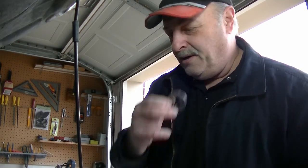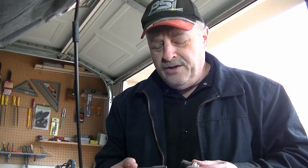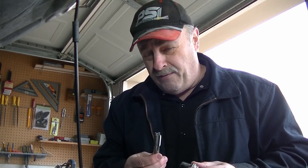All right, so what I got here is an 18 millimeter die, and I have an 18 millimeter tap. So what I'm gonna do, this just came in yesterday, so I told everybody on the Audi forum I was gonna make a little video on this. And that is I'm going to take this tap and I'm going to see if I can just edge past the parts where you have the stripped threads and then you go into the new threads. Now I would rather use what's called a back tap, except I didn't learn about a back tap until after I ordered this. So I figure I'll go ahead and try this part first.